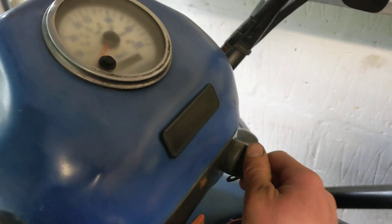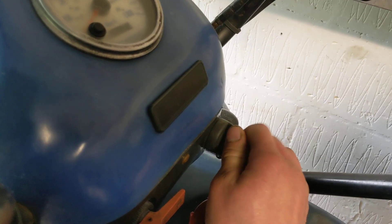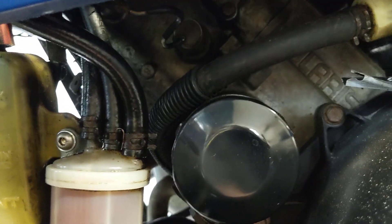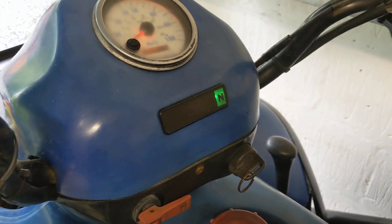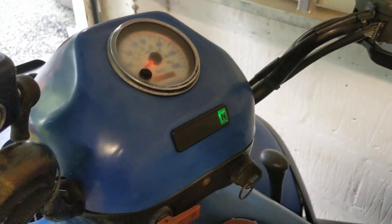I have wired the fans. These overheat and lose the head gasket - that's why the gasket was gone on this one. The fan thermo switch wasn't working; if we look down here, there's the thermo switch and it was just completely disconnected. So that's probably why the head gasket blew - the fan wouldn't have been coming on and it would have overheated. But if I switch it on now, the fan comes on straight away. Runs lovely.